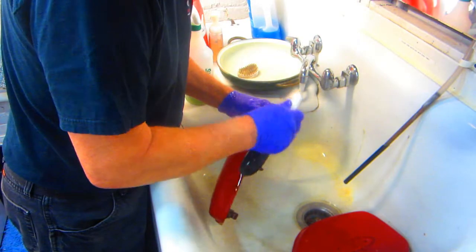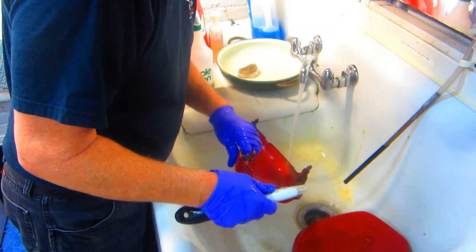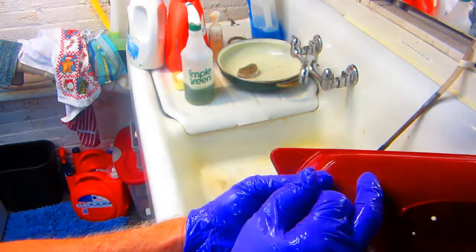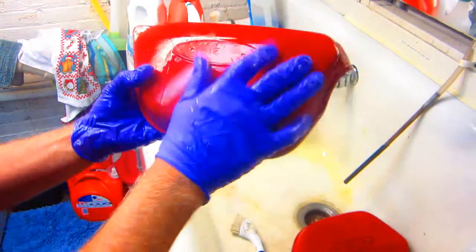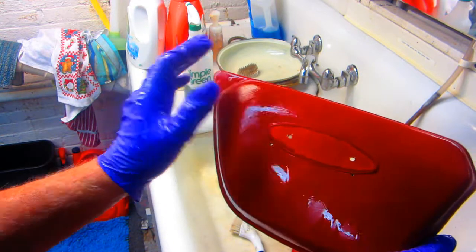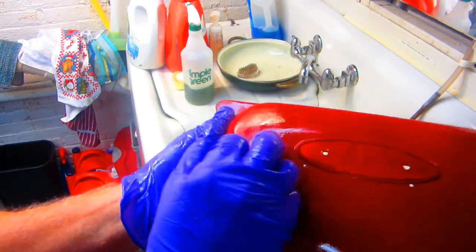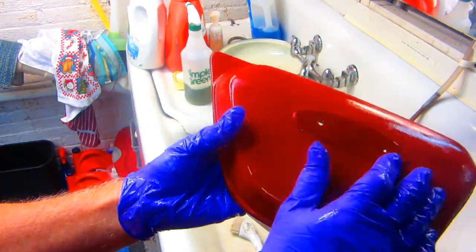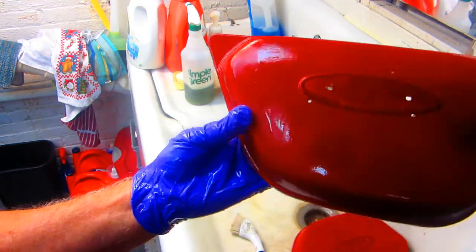These parts are really in good shape for 1972 parts — the little tangs aren't broken. The paint that's already on here has crazed in a couple of spots and is bubbling and peeling in others. I've painted many, many Honda side covers and plastic parts, and if they're not sealed properly the paint will melt. So it's really important to get this old stuff scuffed up, get the parts rough, and get some primer on to seal that plastic.